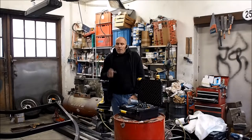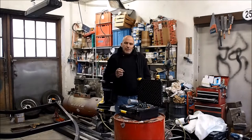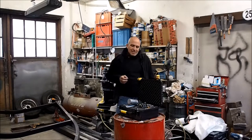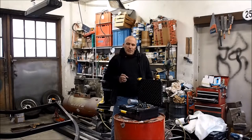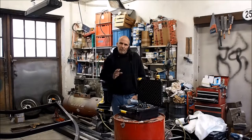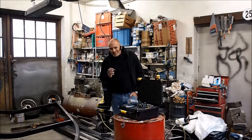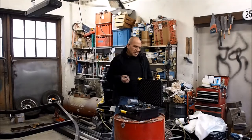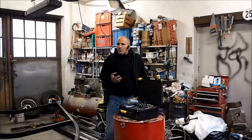So now let's talk about flake sizes. I normally use 0.2 millimeters and 0.6 millimeters. There's also 1 millimeter flakes, but they are a pain in the butt to work with, because you need a really, really big tip. You basically need a 3.0 tip to get them on. If they start to stand in the material, you need tons of clear to cover that. So unless it's a very special thing, I wouldn't use them. I use 1 mil in gel coat, but that's a completely different substance. It's much thicker and it's easier to work with.